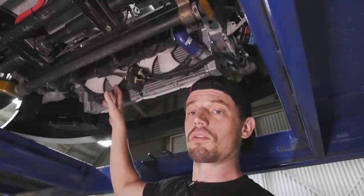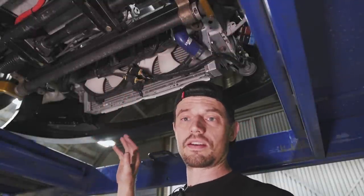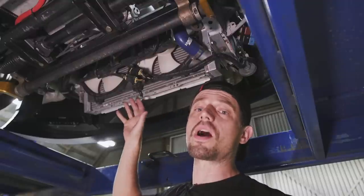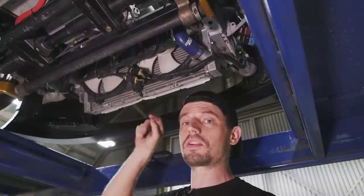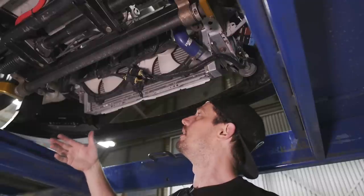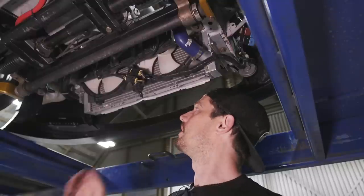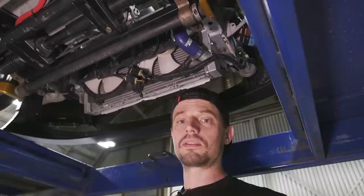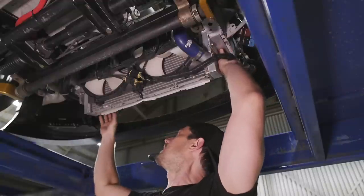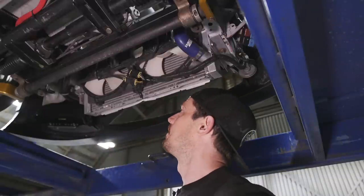Let's get this thing up in the air and get to work. I'm actually already using the stock Mazda fans under here and I'm going to try and use them again on the Sandberg setup. I'm not sure if I can yet, but I'll try just because I've already done all the wiring — I've got the relays set up so when I turn on the air conditioning it automatically kicks the fans into high mode, giving two speeds. Other aftermarket options are just on or off, so I'll keep that for now. It also saves me a little money not having to buy fans. This should be a pretty straightforward installation; the existing radiator is mounted on the bottom of the frame rails and I think the Sandberg kit uses the same mounting style.